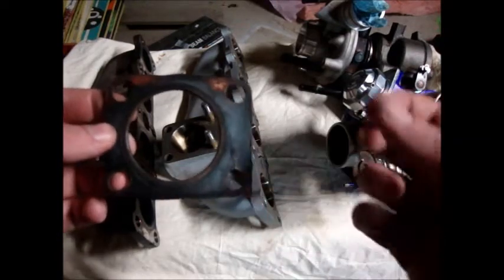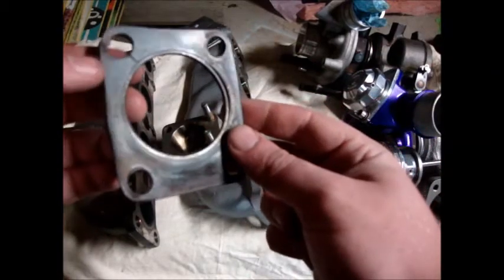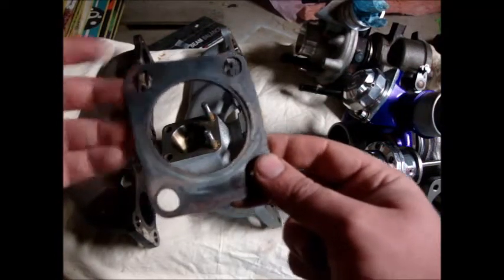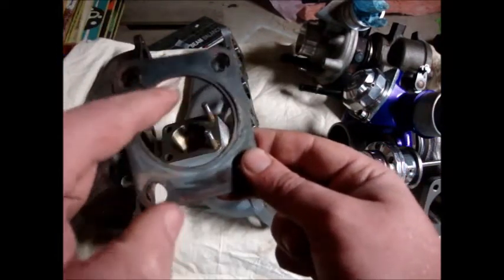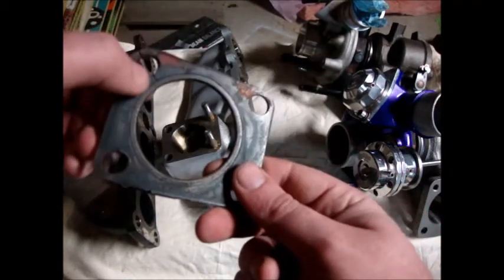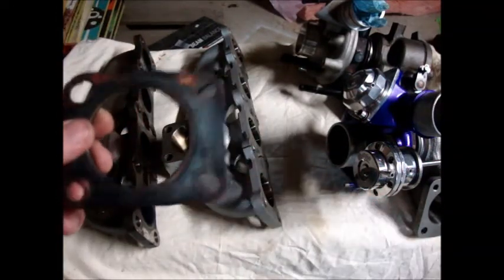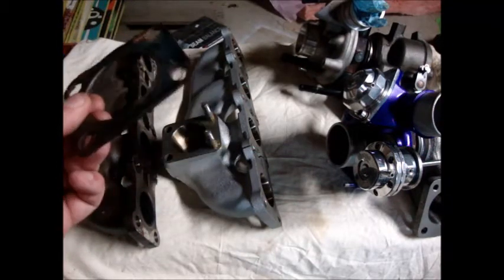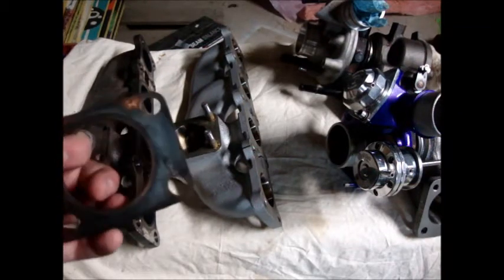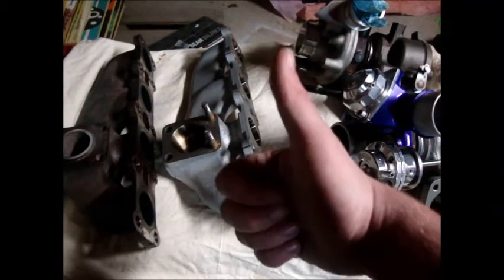But when GrimSpeed talks about the center firing ring and how important it is — you can see that despite actually being installed wrong, it didn't leak exhaust. That's because it had this steel fire ring, and this crack right here goes all the way through, but the firing ring stayed intact and was able to hold the exhaust gases in. Big plus to GrimSpeed — it also warped a little bit because I was running a bit too lean, and it still didn't leak. Good job GrimSpeed.